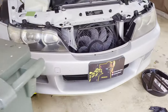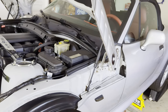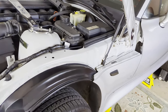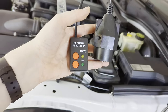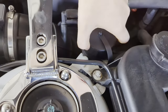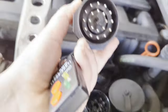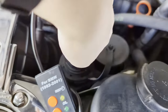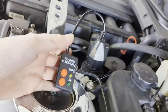After the oil change, you need to reset the inspection and oil gauge inside the car so it knows maintenance has been done and stops showing you're due for a service. For the Z3, there's a special tool available on Amazon — I'll link it in the description. This car predates OBD2, so it uses an older connector port. You unplug the cover, match up the Pac-Man-shaped symbol, plug the tool in, and it has two buttons: inspection and oil.